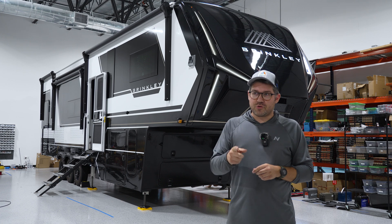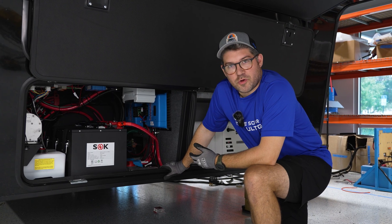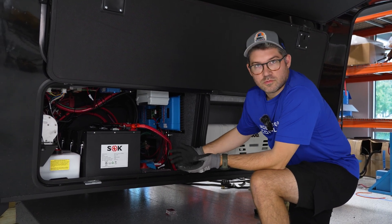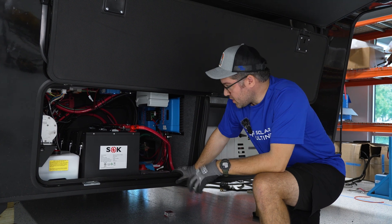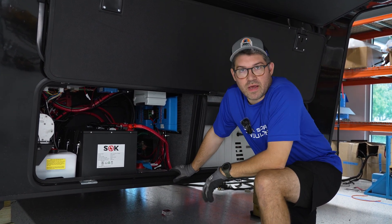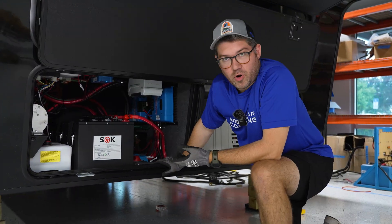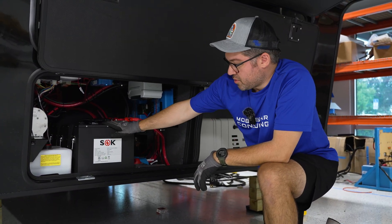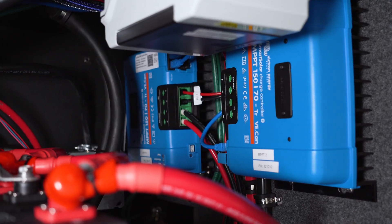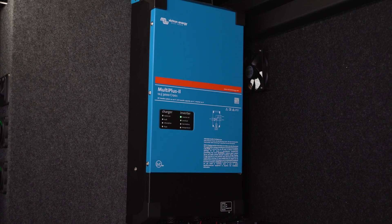It's not the traditional black pipe that you'll find on most Brinkleys. We're here in the front bay, and you may notice this is a little bit of a smaller build than some of the other Brinkley jobs we've done. Even though you have a large rig like this, you don't need a massive solar installation necessarily — it kind of depends on what you're going to use it for. In this lower compartment we've got three SOK 206 amp hour batteries, and then two 150-70 MPPTs with the inverters right above in the upper compartment.